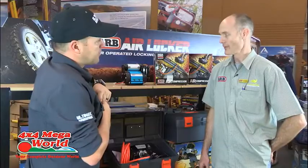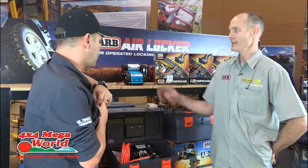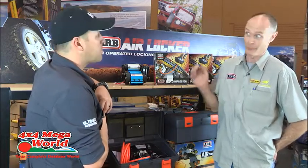There are many good brands out there. What sets the men apart from the boys is that the ARB compressor can be fully repaired and serviced — there are spares available for everything. If it packs up outside of its warranty, we can still fix it. Another plus point is it can handle the back pressure of a tyre that's almost full very well. A lot of compressors have a big delivery, but when the tyre gets harder and back pressure builds up, they just fade away.